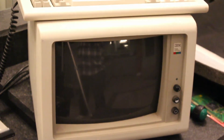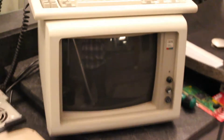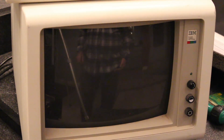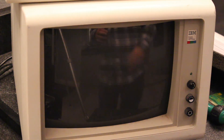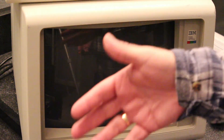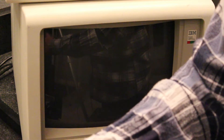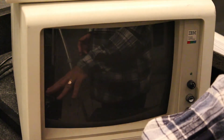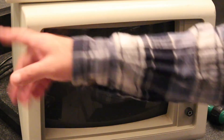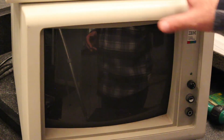Let me focus in and you and I can witness this boot up together for the first time. Normally some folks take the cards out to check the capacitors for shorts, but I'm going to go for it because I see nothing — this board is clean. Worst case scenario, we unplug it if we smell smoke. I already got the monitor and keyboard plugged in, so let's see what we got.